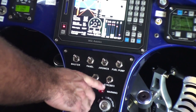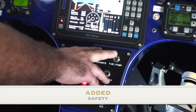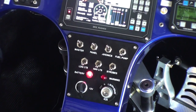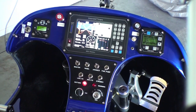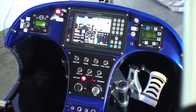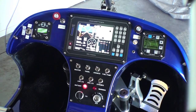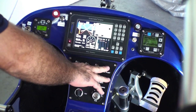You can hear in the background an electric fuel pump, which is really nice if you haven't started the engine in quite some time. With trikes where the gas tank is lower than the engine, people usually have to pull the bowls off the carburetors or just crank and crank. With this, you could leave it sit for three months, turn the electric fuel pump on, pull the choke out, and it's going to start right up with fresh fuel to the engine.